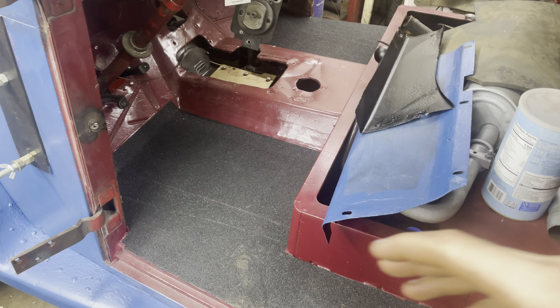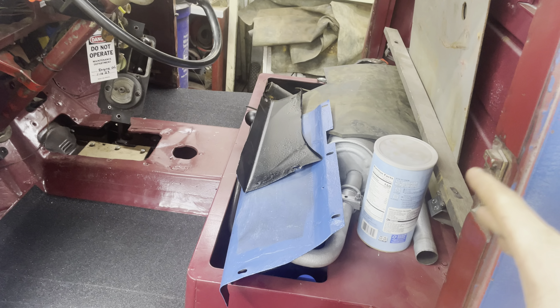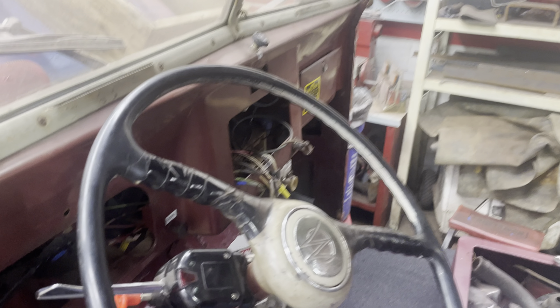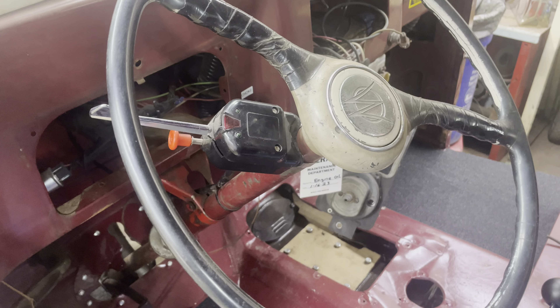The floors and cab seats are done - they're done in the house, haven't shown them yet. There's a speaker mount that still needs to go up; I'm still trying to figure out mounts for the boss speaker onto the dashboard. For the dash panel, I'm going to keep my old panel - it has speedometer, temp, and oil pressure. I'm going to keep these centered because they work, and just reconfigure the wire lengths.